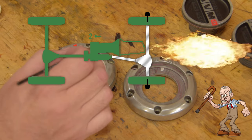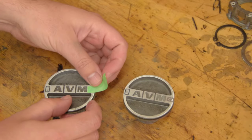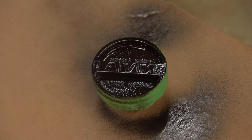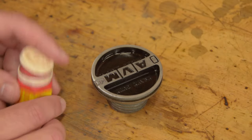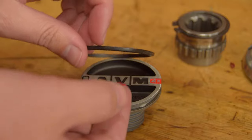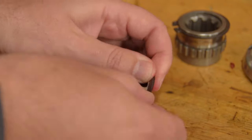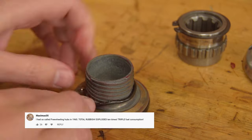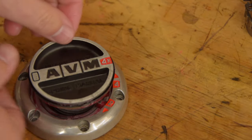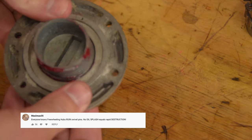A lot of people think they're a load of crap. So why don't people like freewheeling hubs? In terms of improving mileage or saving wear and tear, why add an extra mechanical complication for snake oil? But in terms of Land Rovers, the main objection that seems to be widely accepted is that because the front half shafts aren't spinning around, oil isn't flung up into the top steering pin and bushing, and they will be destroyed.